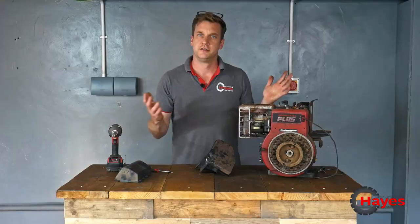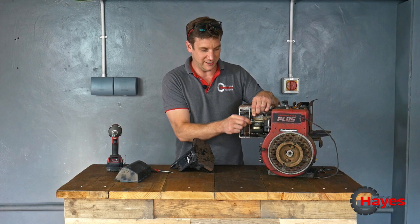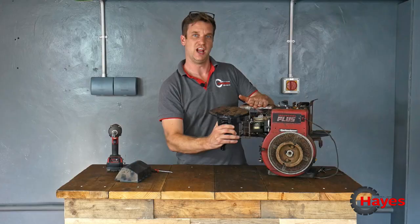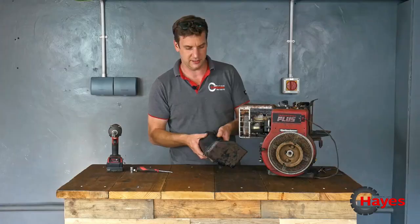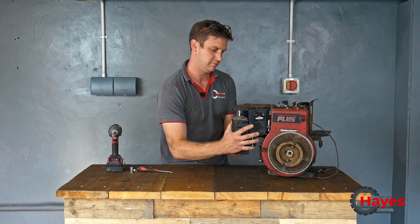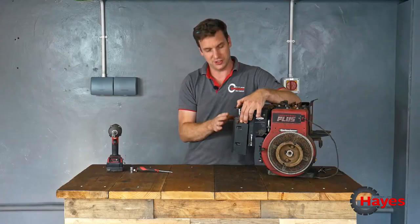So there we have it — we have our nice little carb there. The biggest issue is the choke lever obviously works here. I've looked around to see if we've got a different butterfly to work in here so we can put the cable onto there instead. But I think we're going to have to cut this up to be able to lower that down. The air filter clips in on the tabs on the side — the tabs are all the same spacing, so we could lower it down one tab, which brings the level down to the same height as the exhaust. So if they're at the same height, our bonnet's going to close.